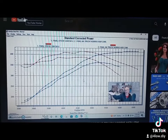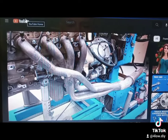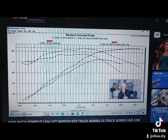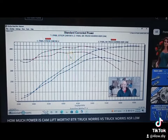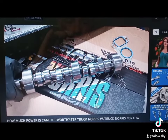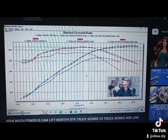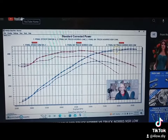You can imagine how much more power you're going to pick up if you swap out the heads, go with bigger valves, a more free-flowing intake, and put some boost on it. You're looking at 60 to 70 horsepower gain and 40 to 60 on the torque. The main thing to me with this cam — and why I chose it over all the others — is you don't lose anything on the bottom end. This truck is easily 5,500 pounds with a camper shell; it's a heavy truck and you need that torque to get moving. For the budget guy, the NSR cam is definitely the way to go.